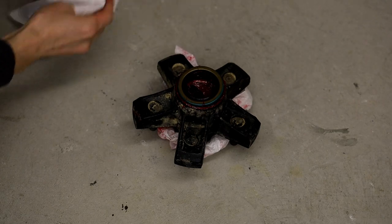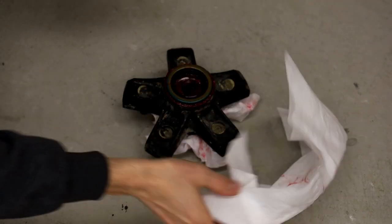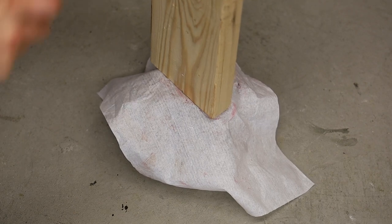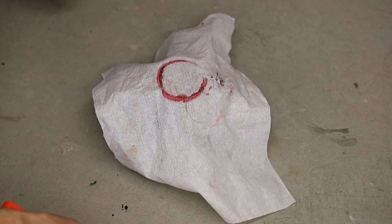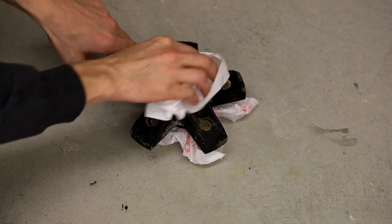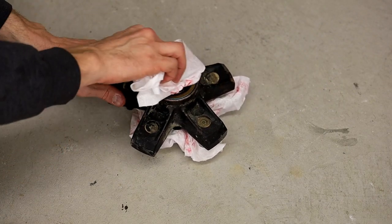And if you look at what's happening, you can see that it's starting to turn a little bit. That's kind of normal. We're just going to tap that down an extra smidge. And this seal is going in literally perfectly square. It's all you could expect. So you just tap it flush. And it takes you all about that long. And then just feel it, test it, it's good. And everything's good at this point. I'm going to wipe the extra little bit of trash off the back. Just check to make sure my spring is doing its spring thing, and I don't see it, so that's good.